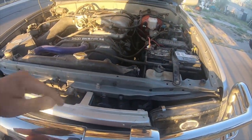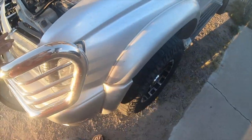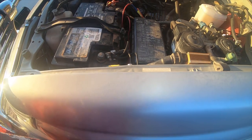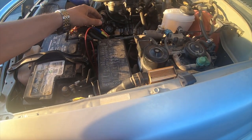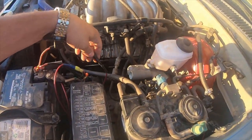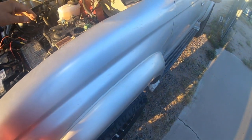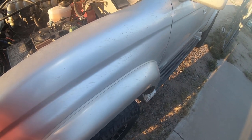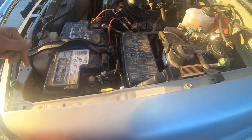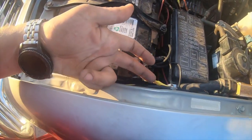I did not take anything other than the bumper forward — I did not remove the ram guard or any of these lights. It's a pretty easy job, other than it took me all day because of time restraints. The fuse link goes to the red wire inside the vehicle, which is linked to the relay and the switch. Ground goes to the relay and the switch. The yellow wire is the switch hot power out — goes straight from the switch all the way to the compressor, and then this ground is the ground to the compressor.